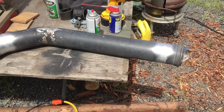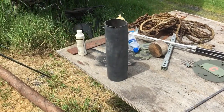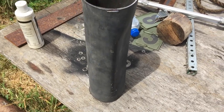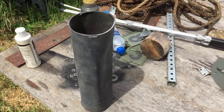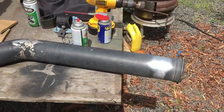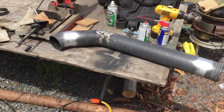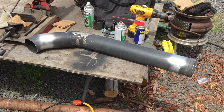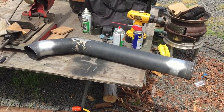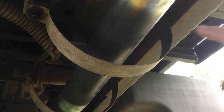Now this is the custom side. This is Patricia's extra five-foot-long pipe, and I cut off a small section — this is the section that has the little indentation to avoid the front shackle, or the leaf spring shackle. So this is short enough now, with a nice little downspout that should direct the exhaust right at the ground, just before the rear axle. Let's go see how it fits.